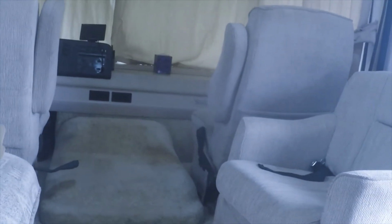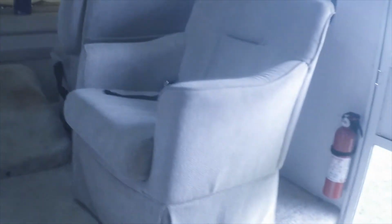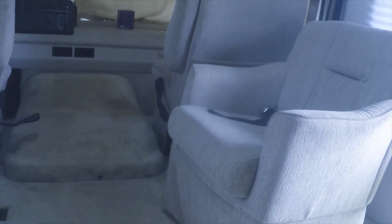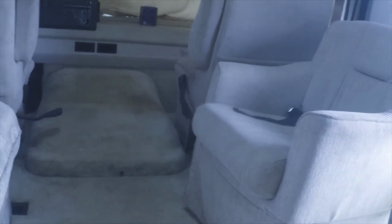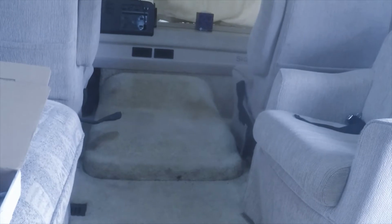They've got that drum brake on the end of the tail housing with the parking brake shoes in it, and then it's got that actuator that unapplies the brake. It applies the pressure on that cable anytime you're driving down the road. So you've got to have that pump and 1,500 pounds of pressure pushing on that cable anytime you're going down the road. And if you don't, the fail mode is it locks the transmission up, or it locks the drivetrain up.